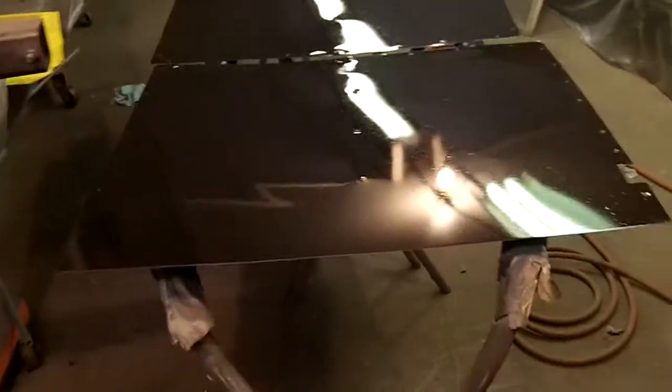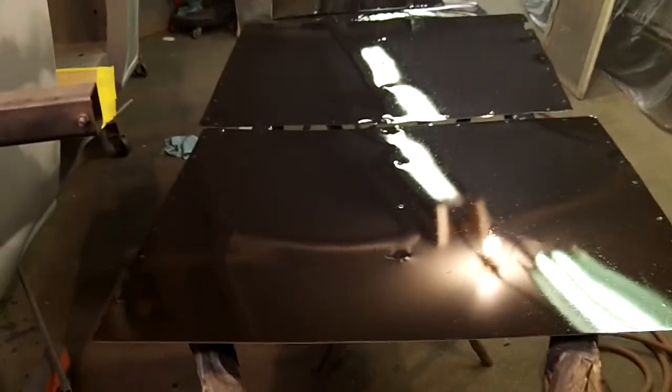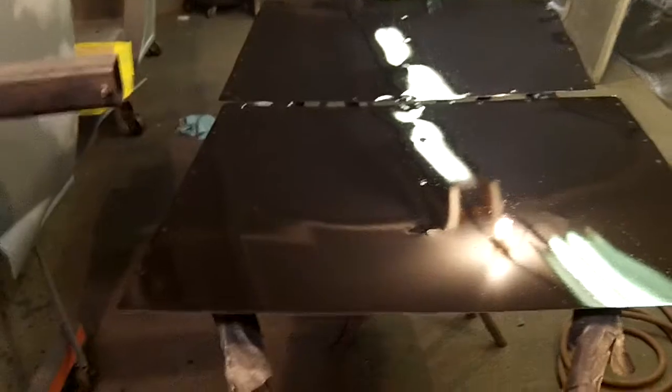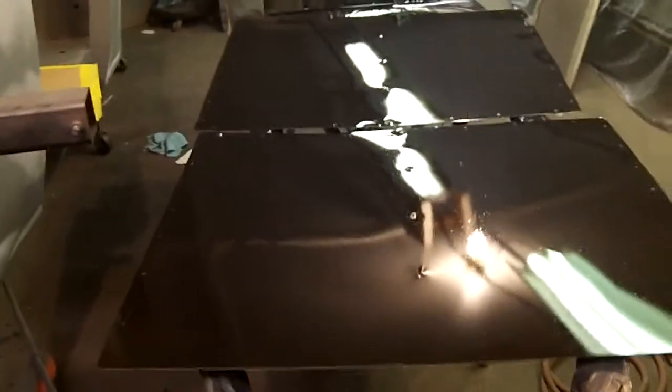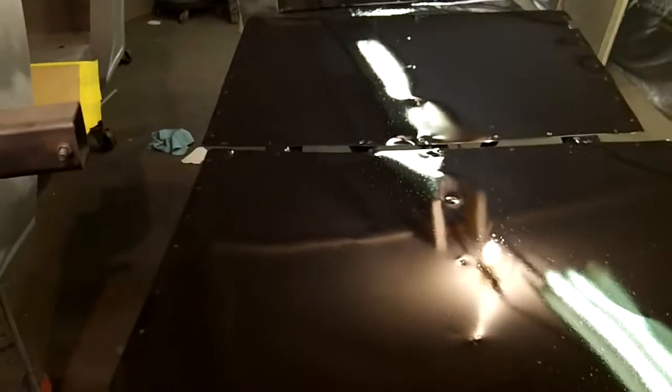Alright guys, I'm gonna do another quick video here just before 10 o'clock. And if you can see all the dust in there, good for you. This is just epoxy primer. These are the interior door panels, the inside. So this side is gonna face the inside of the door shell, the inside of the kick panels. Just has to have something on it so it doesn't flash rust. Flip them later, do the other side later, blah, blah.